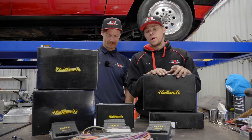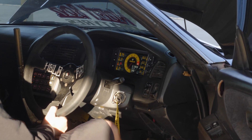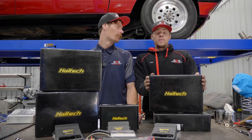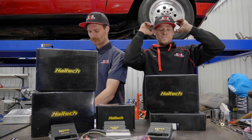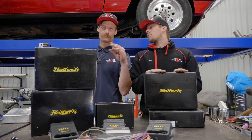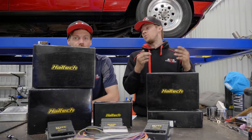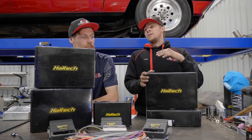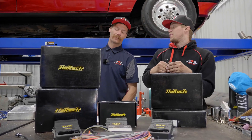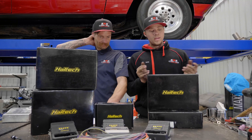User adjustable, and when coupled with one of these ECUs it's basically like a very good replacement OEM dash — I'd nearly say it's up there with one of the finer ones. There are obviously cheaper options that run off OBD, but this talks directly to the ECU via CAN and can display anything that your ECU can see. The setup display of the dash is completely customizable.